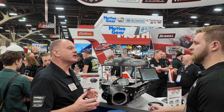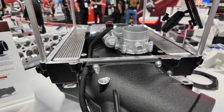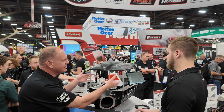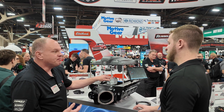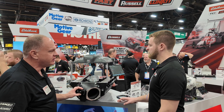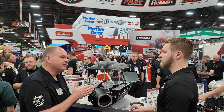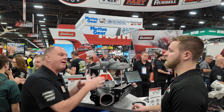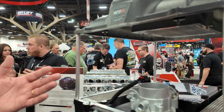You can see the electronic bypass valve here. When the unit is assembled, this chamber is pressurized by boost, and the bypass valve allows you to recirculate that. The traditional function is to protect the rotors and the throttle body — when you shut the butterfly on the throttle body, you want to bypass that boost so it doesn't back up. But since we're electronically controlling it, we thought, why not create a boost control feature?